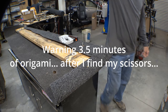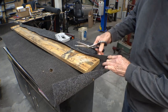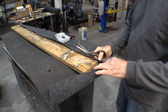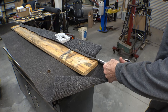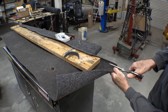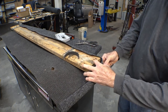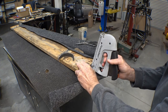Trimming the carpet: I'll cut straight down to the corner, because I know from folding the other one that this part is going to fold over the top, and this piece needs to be about this wide. I'll make this section about this wide and stop just short of the corner so it holds together and ends up with a fold that covers everything without leaving a hole.